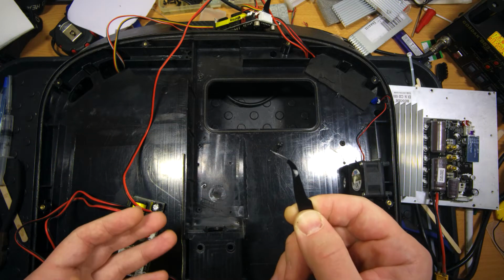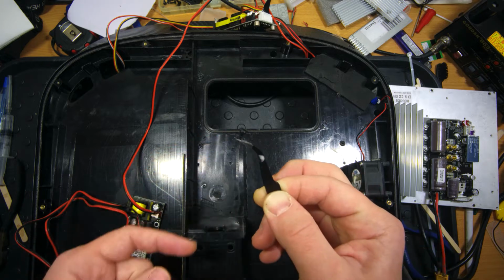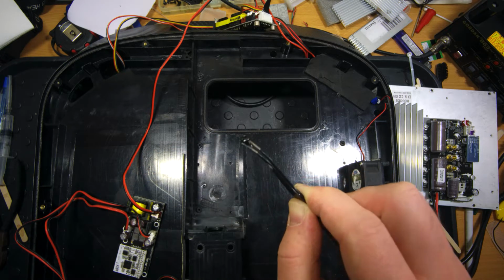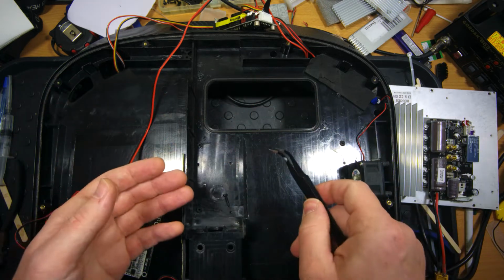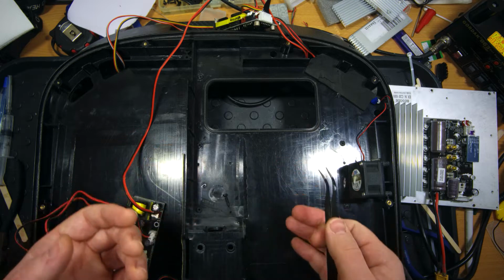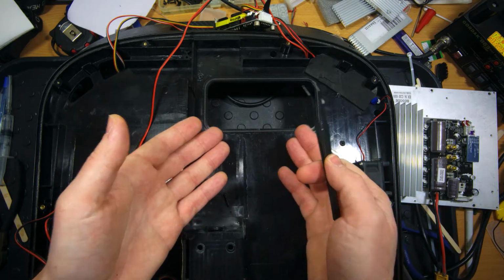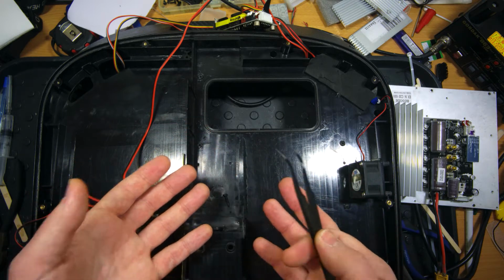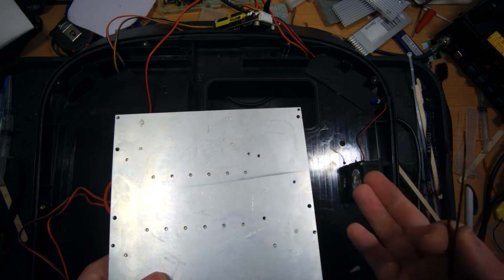And just imagine one thing, that when you are riding 60 kilometers per hour on this wheel, the only thing which saves your health and life is these wooden screws. And if they untighten due to vibrations, which will obviously be on this wheel when you are jumping, when you are riding roads, you might get some tremor of this wheel at high speed, and you know the result will be very upsetting.